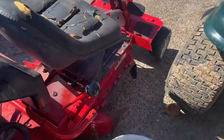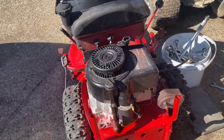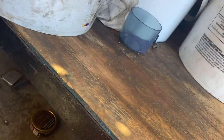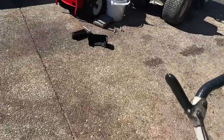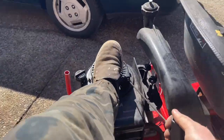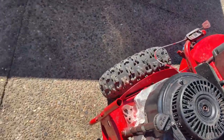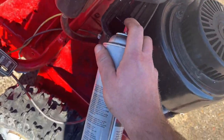Yeah, now it's time for a compression test. It's about 65-70 PSI - that's enough to run. The problem is I grabbed non-flammable brake cleaner - that's not gonna burn. I found another good brake parts cleaner that'll start stuff. Yeah, that's what I'm talking about - that'll run it. Now I'm going to use a hotter two-cycle plug here. Oh, success! Shoot a little bit of this down the carb. Yeah, that non-flammable brake cleaner - I'm gonna quit buying that stuff.